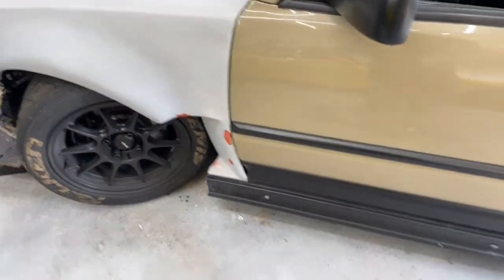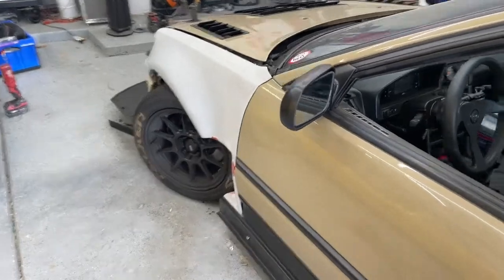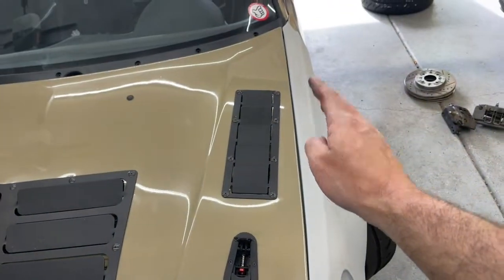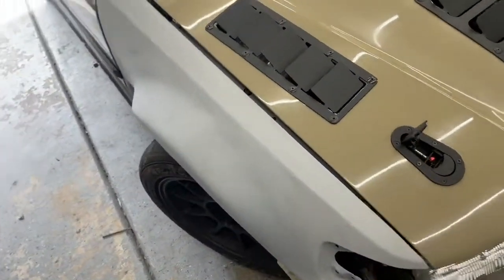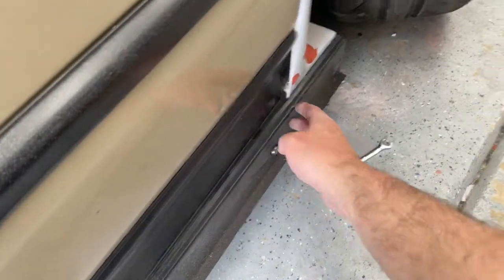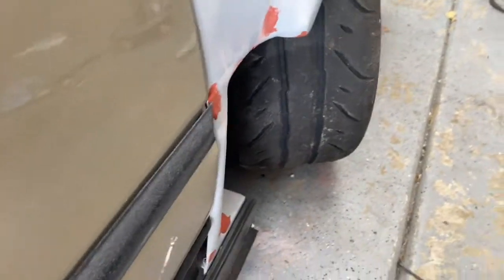For the most part it opens up fine, and you can see the gap difference - the bottom is more open, but that's what it'll look like. She's pretty bolted up with two bolts in it. The fender gap at the front looks pretty good, and naturally it's going to get bigger towards the back because the hood is raised. The other side is maybe just a skosh wider but I can live with that. The only difference with this side is I need to tighten it up and push it in a little bit. This is going to have a little bit of a drop off but I'm done - it's going to look great when it's all painted up.